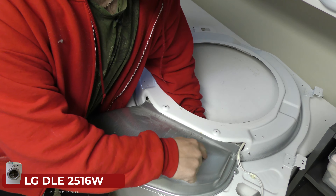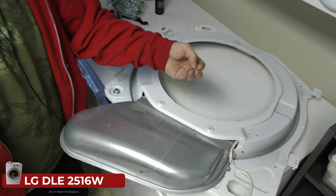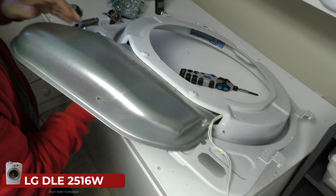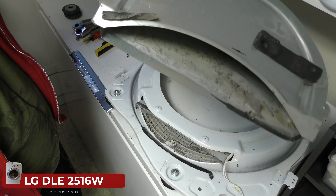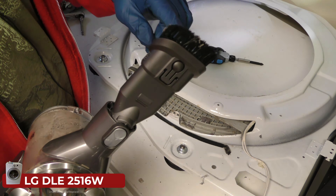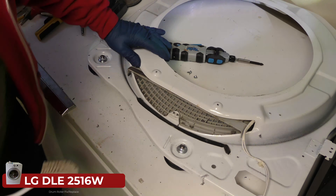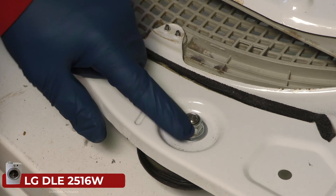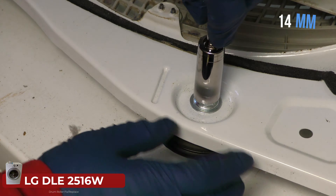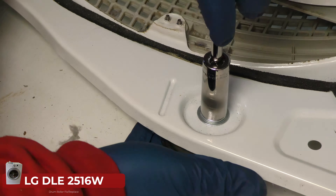We have to flip it over to see how to take off this wheel. The bolt is right back behind here. There are two machine screws of equal size — there's the wheel. We might clean inside of it too. We'll clean all the junk in here with the brush tip, and if that's not enough, we'll use the larger brush to dislodge everything. Now we're going to remove these bolts. It looks like it's going to be a 14 millimeter with very little play.